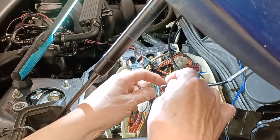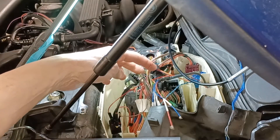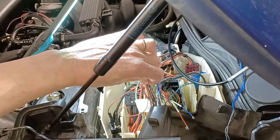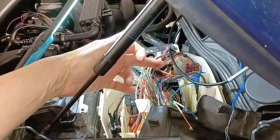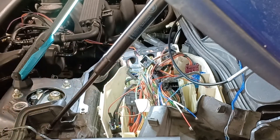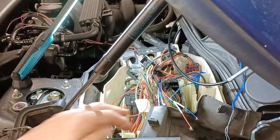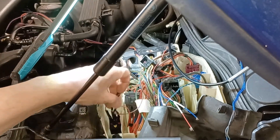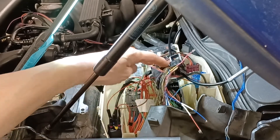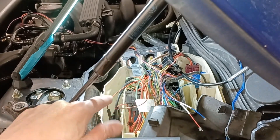CAN bus low is marked as CAN minus. I've pulled a plug off of the ECU and within that plug there is a CAN bus connection: the red wire is CAN low and the blue-and-red wire is CAN high. That gives me the two CAN connections. For the ground, I'm going to splice into the same earth I used for my CARTEK isolator switch.